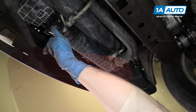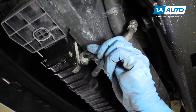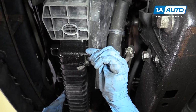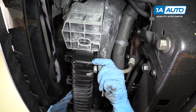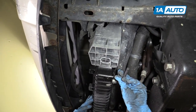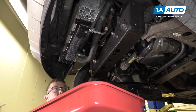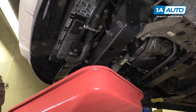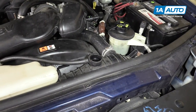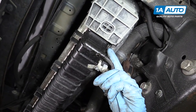On the driver's side front of your radiator, there's a drain. You can see the little drain hole here. There's usually a white 8mm nut here that you can loosen — it's also an 8mm socket or Allen inside. Loosen it up and your fluid will start draining out. We've already drained the fluid, so have a drain pan underneath to collect all your coolant. While the radiator's draining, remove the radiator cap, which will allow air in and the fluid to come out faster. Once your coolant's done draining, close the valve back up.